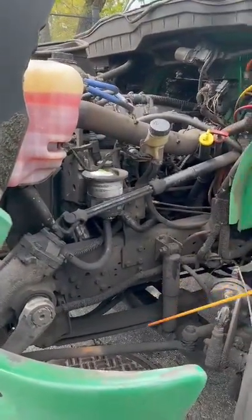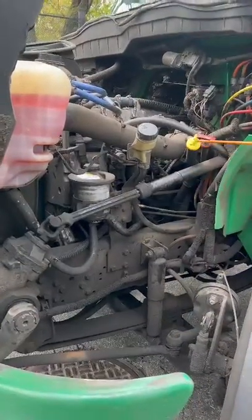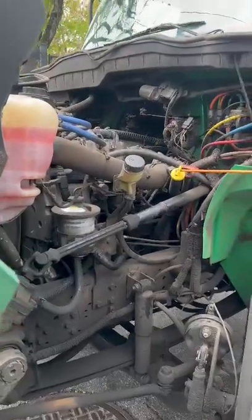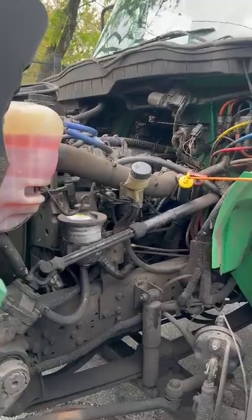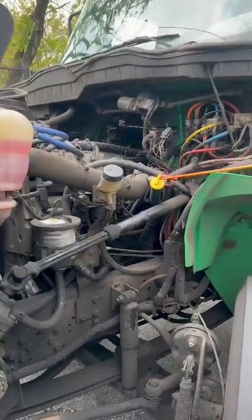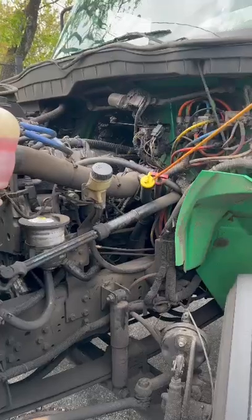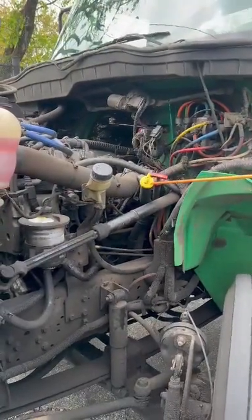Engine oil, transmission oil, fluid, and defroster. My engine dipstick has not been broken or cracked, it's secure. The way I would check it is with the engine off — I would pull it out, clean it, reinsert it, take it back out, and make sure it's at the proper fill mark. If it's low, I would refill it through the dipstick hole itself, since there's no engine cap.